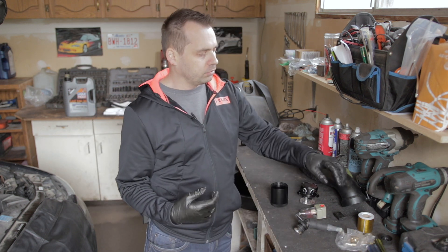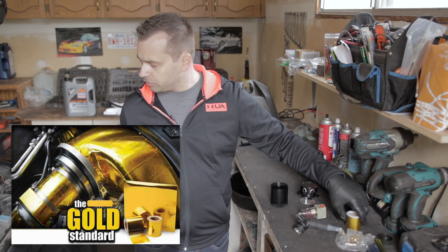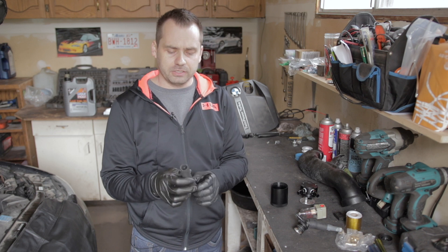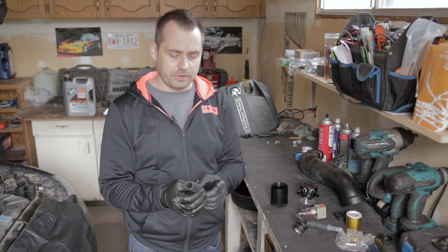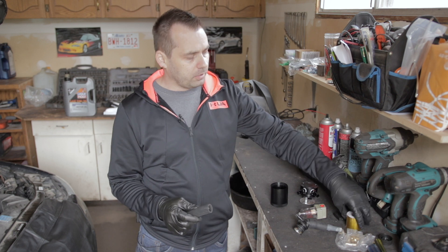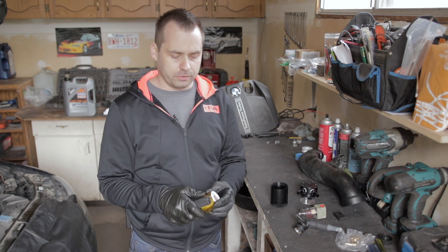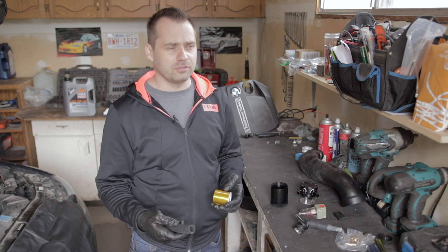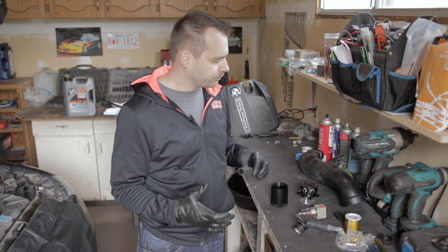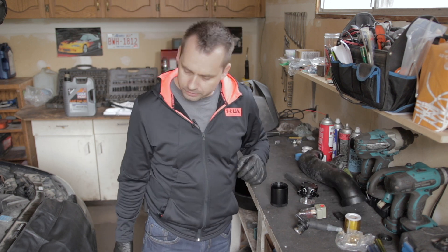What I personally like to do is use a little bit of Teflon gold tape. The reason is that the engine bay gets really hot, and rubber hoses tend to squeeze — especially when used for vacuum — and can eventually get squished and stop the airflow. If you shield the hose with gold tape, there's a great chance you'll fix that issue as well.